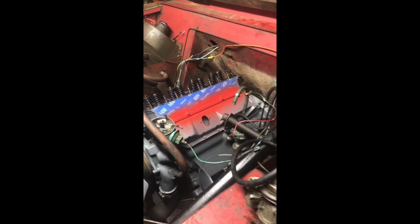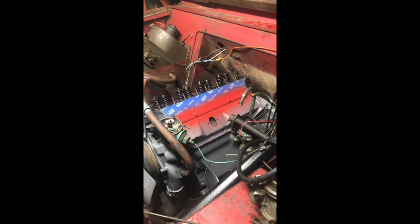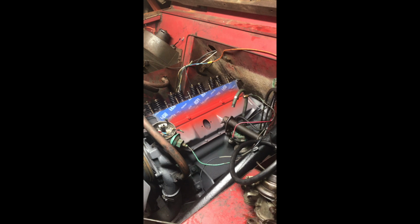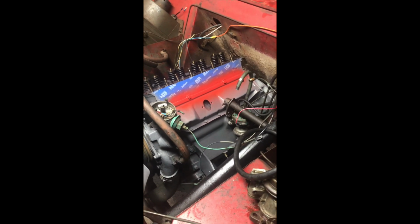And it was really kind of loud, and I determined that it was stuck lifters. They are hydraulic lifters, that's why I'm able to take them apart. So I cleaned them. There's other good resources on that, like I said before. And so now I'll set you guys up, and I'm going to start painting the rest of the engine.